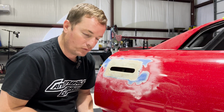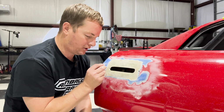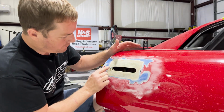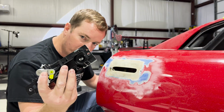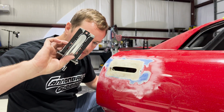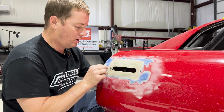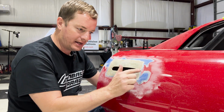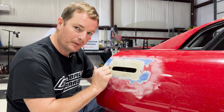Now in theory that should work, but you're probably asking yourself, how will it work if you stick the bolt through here and have a giant bolt head sticking out? And also, it's pretty close to the edge right there because there wasn't a lot of room that I had to work with when it came to this here. So this is how I'm going to do that. These are a little bit in. This area is a little bit in on both sides. It's almost flush, but I'm still going to grind this down to where it's a little bit thinner.